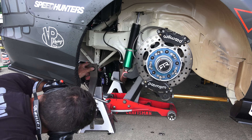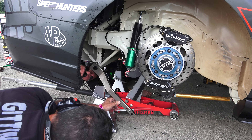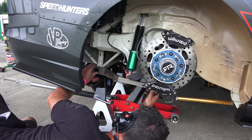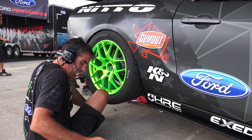You may have noticed the brakes are drilled, and this isn't something common in motorsport. In drifting, the amount of braking is low, and thus the amount of heat rejected into the brakes during a single run is quite low, so they can get away with using unvented drilled rotors without worrying about stress risers causing cracks. The large drilled holes are there for weight reduction purposes.